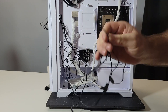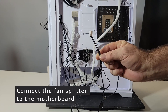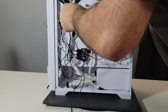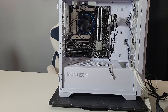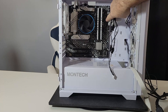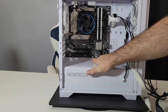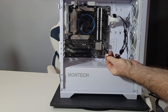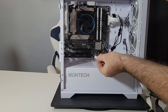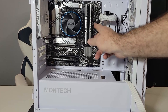All four fans are going to run off the motherboard off this one pin, so this splitter needs to be attached to the motherboard. On this particular motherboard there are two spots — the CPU option pin, or one fan header right behind the 24-pin. I'm going to connect to the one behind the 24-pin. Depending on your motherboard, you may have one in various locations — it doesn't matter, as long as it's an empty fan header. Notice this is three pins and the header is four pins — that's okay. It has a clip, and as long as that fits, you only need three pins for the power. The fans are now hooked to the motherboard.